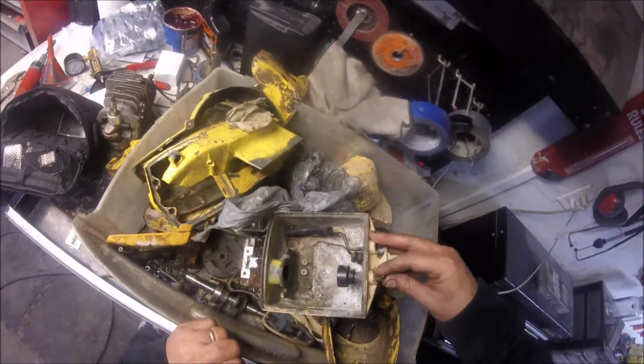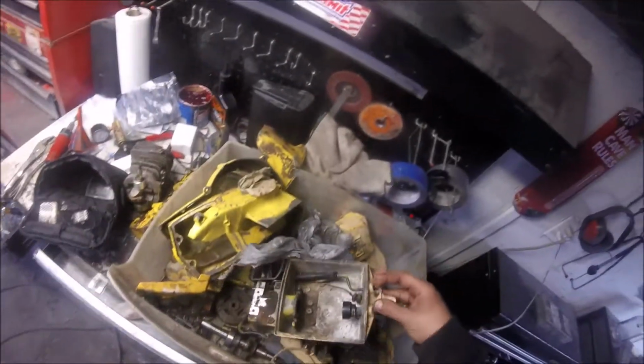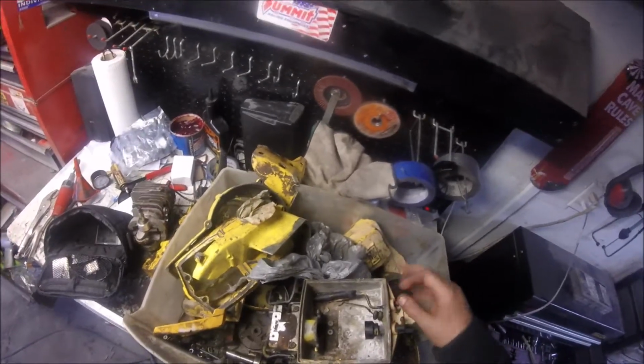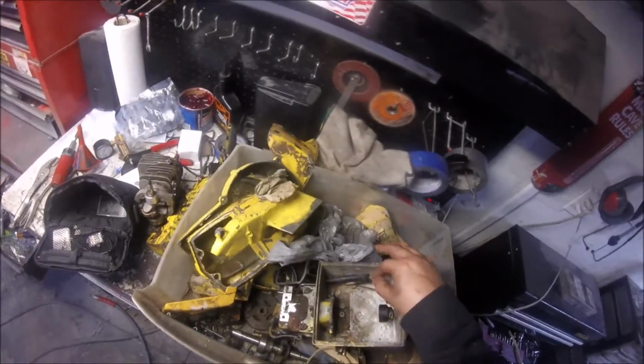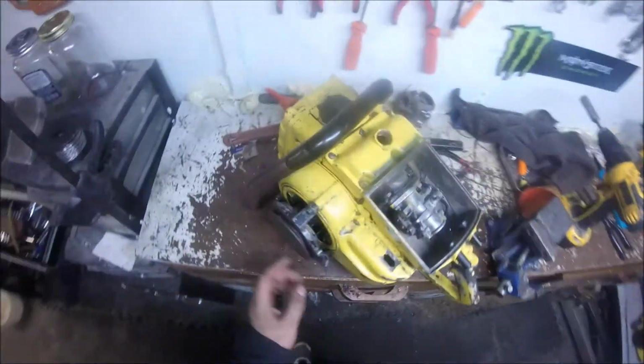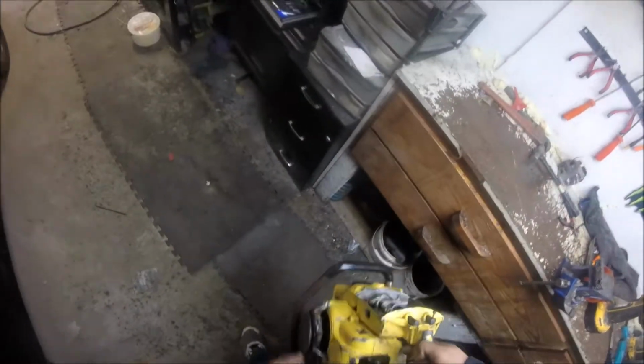And the way the choke on it works is it has this plunger deal. Goes into the back of the carb, lock it down. Chokes it. Pretty simple design. But I've also got to change the rod for the oiler. No big deal. The problem I'm having now is that spring broke, and this is shredding my new rope to bits. So maybe it'll pop on this pull, maybe, or maybe not, I don't know. Yep, she broke.